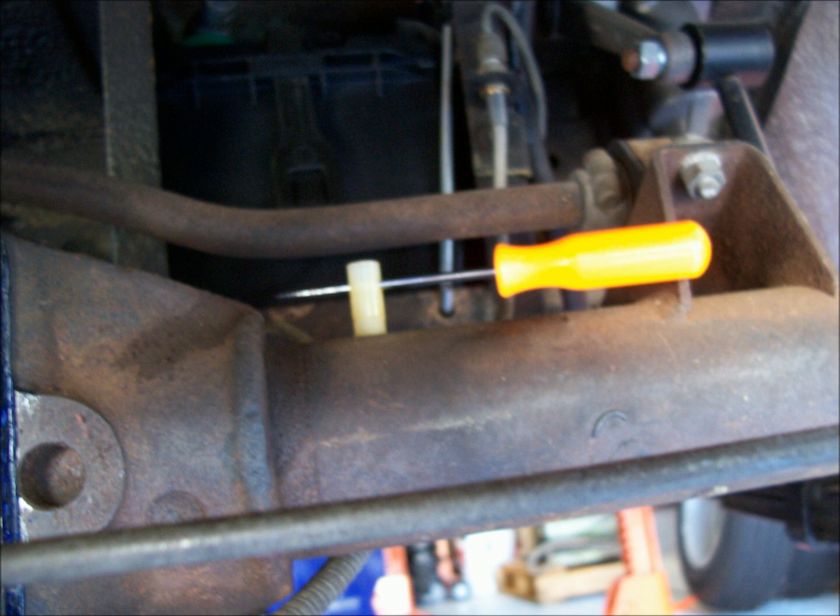While waiting, I removed the nylon vent pipe from the axle. This is done by first pushing up on the vent cap, which pops off. I then used an awl and passed it through the 2 holes in the tube opposite each other to provide leverage to unscrew the vent tube.